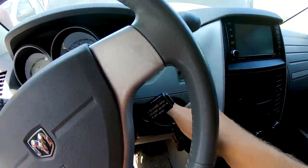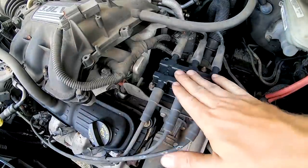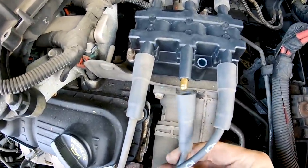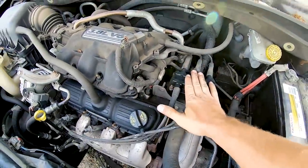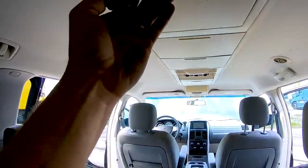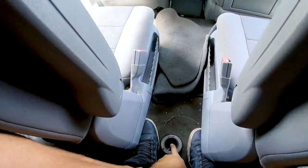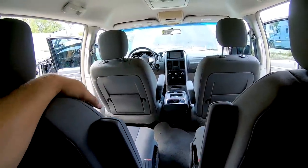Let's see if we still have the misfire. Let's see if we got spark on number four. There we go — we're getting spark. That means it was this coil pack all along. This Dodge Caravan SXT literally has two TVs — there's one right here and one for the front people. And this lifts up with a little pole inside — the pole goes right there and it becomes a table. These old vans thought of everything.